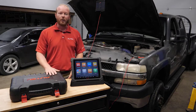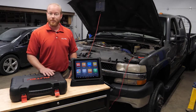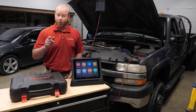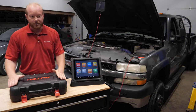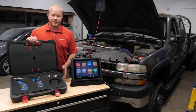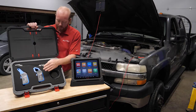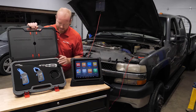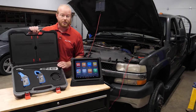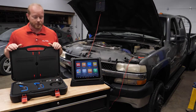To do that, we're going to need an amp clamp to measure the amperage pulling from the battery from the starter. We're going to do that using the oscilloscope accessory kit that is new from Autel Diagnostics. This oscilloscope accessory kit includes a 65-amp amp clamp, a 650-amp amp clamp, a signal probe for coil-on plugs, along with a couple other adapters in the lid for coil-on plugs.